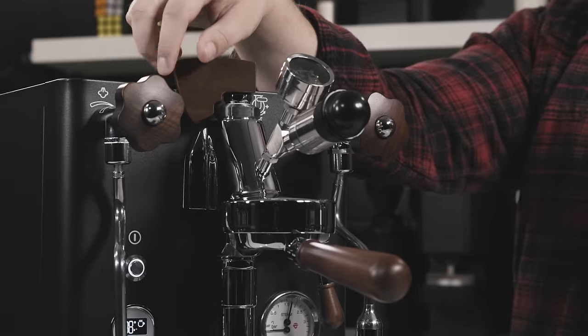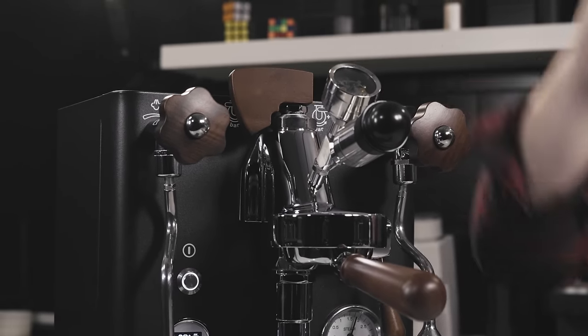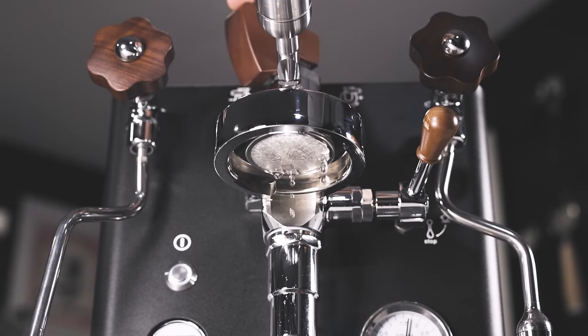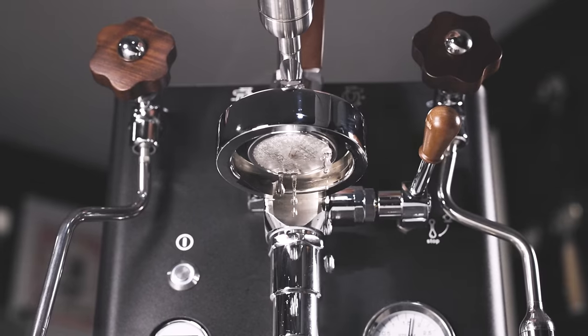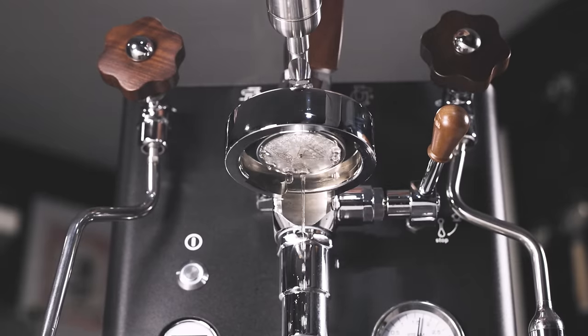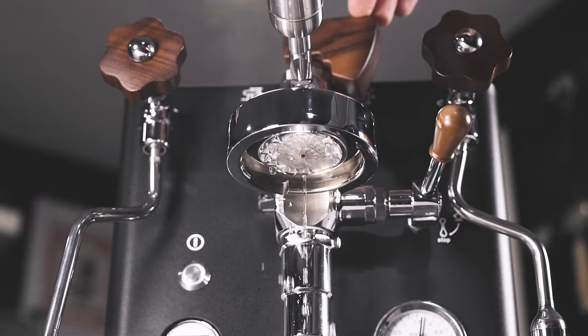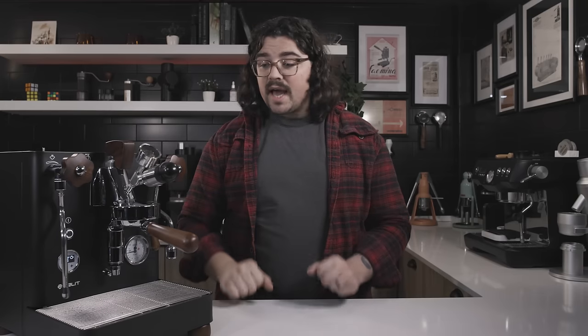One big difference is at the top: where you would normally just have a jiggler, this one has a needle valve. The needle valve lets you control the aperture of water flow, giving you complete control over your flow rate. On this machine I've measured it as low as about 0.4 milliliters per second — it can maybe go a little lower — and all the way open on mine is about 6.5 ml/s. You can change the needle's position manually. This flow control comes stock, which is really nice.